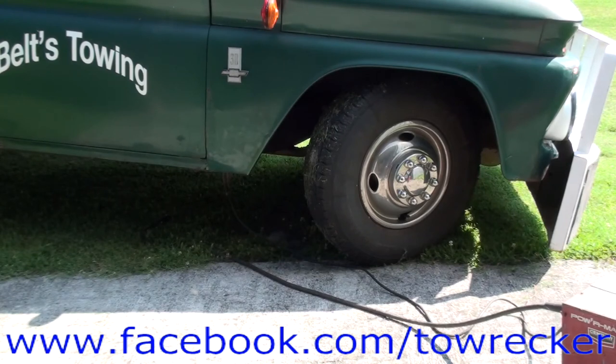You can pretty well modify body lines however you want to, just make sure that you do it across the board, like down the whole side of the vehicle. An upper body line on that truck, I wouldn't suggest you try to fill that in with Bondo, but I guess you could make an interesting looking truck if you did. You could fill it in with Duraglass, but not only would it be expensive, it would be strange. But you could build that body line up and make the whole side of that truck slick and straight. You can make a custom job. A lot of people have made some custom looking deals, but that don't mean we have to like them, does it?